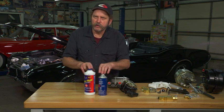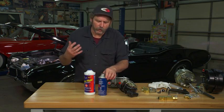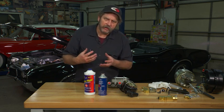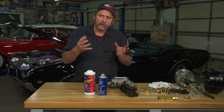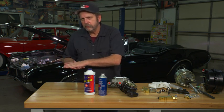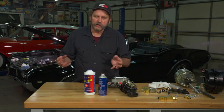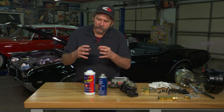The other brake fluid that is probably best used for race and performance applications is DOT 5. When DOT 5 first came out, a lot of guys were grabbing it because it's silicone based. If you spill it on your painted surfaces, it won't interfere with the paint. The silicone in it also wouldn't rot or interfere with the seals.